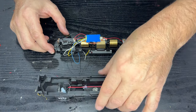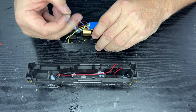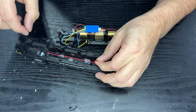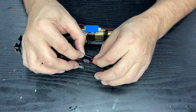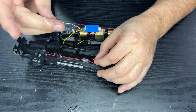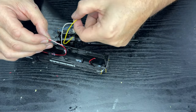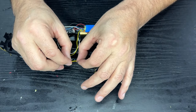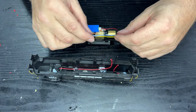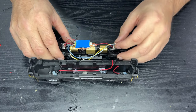So I currently do have LEDs installed and I've trimmed the wires. The way this works is the blue wire has to connect to the positive of the front and the rear - these two red wires. I'll twist them together and solder them - that's the common positive, the blue going to the positive of both the front and the rear. The white wire is the front negative, which will go to this black wire going to the front. And the yellow one goes to the negative of the rear. That's just soldering some wires, so I'll bring you back when that's all done.